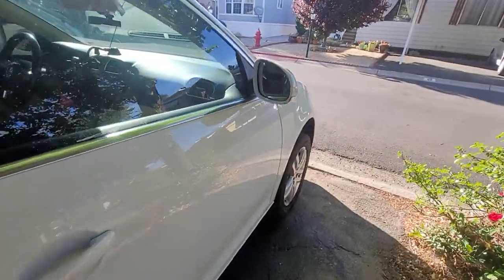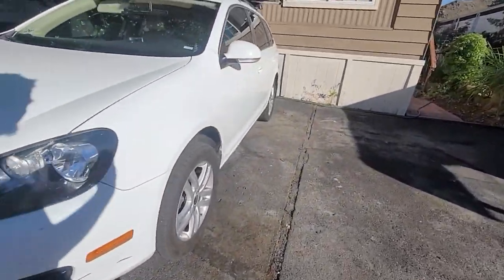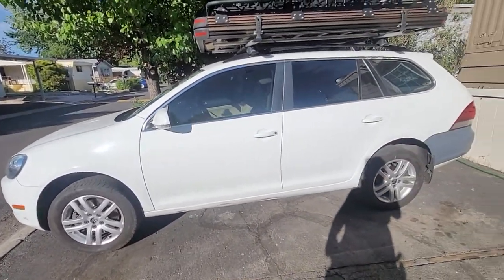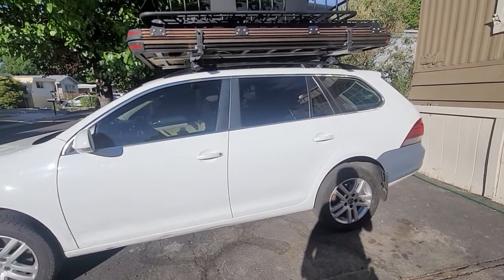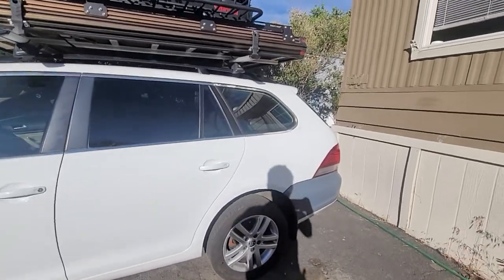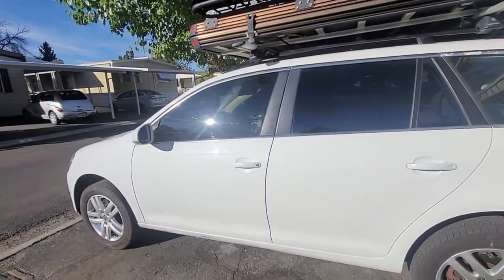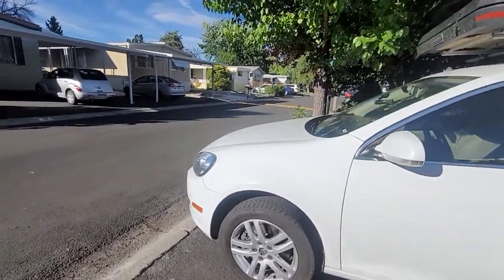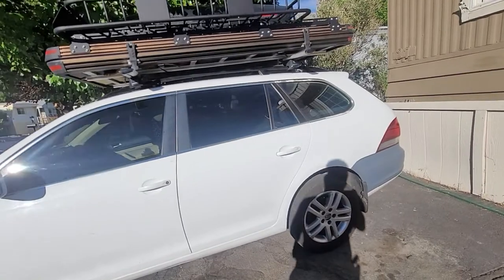So I had to take them to the shop, and you see the front's got a little bit more elevation, it seems, right now. The shop screwed me over. They said that they were going to have it done. I bring it on a Thursday morning at 6, and they said they're going to have it done by Friday in alignment, and they didn't have it done. In fact, they even changed the shocks, and they didn't put the right springs on. They left the springs in the back of my car, and they just reused the old springs. They reused the nuts and bolts, even though they're supposed to be single-use nuts and bolts. So unfortunately, they've got the single-use bolts in there, and I had to pay another shop to do the springs, and it hasn't been aligned yet.